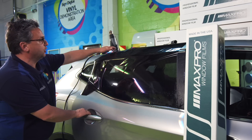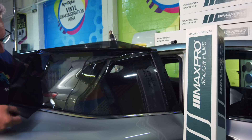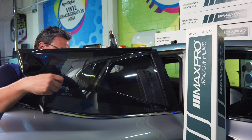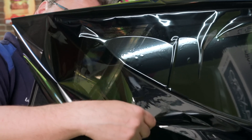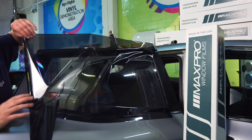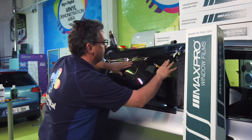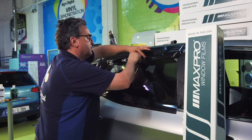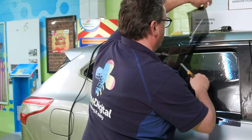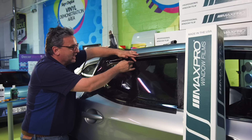To do that, open the door and hold it — be sure it stops moving. Then hold it here. Lift safely, slowly out from here. You can see I have a perfect cut down there. Lift it out, then just roll the window down little by little till you can see you have a light gap. So now it's back and the window is down. Check everything is in, then point in the knife there in the light gap and have a finger in front of your knife just to hold the film down so you have a nice cut at the edge of the window. Again from the middle and out. Look at the angle of my knife — it's angled just a little bit. You can actually adjust it here.